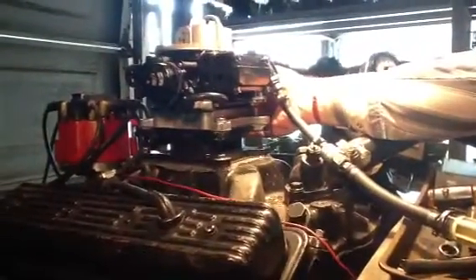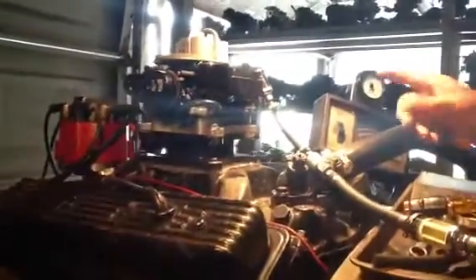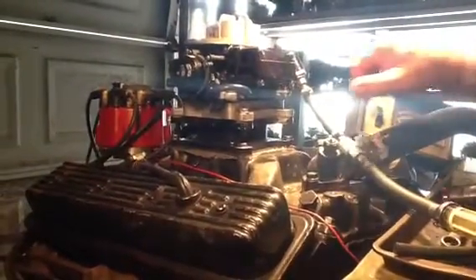And you watch the mixture — it's going to turn out when you accelerate. That's because when you overcome the inertia, the first pull, like a water ski, you get by with a thinner mixture. The resistance is not there.